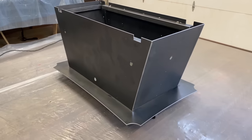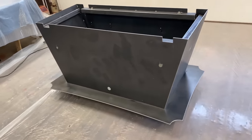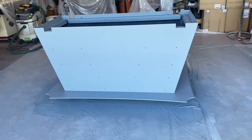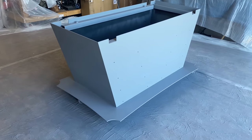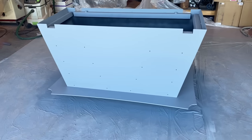Okay, bodywork's done. We're all prepped for some color. We're about to hit it with some primer. All right, one more coat of primer to go. Everything's been sanded in between to 320. After the final coat, we'll sand to 600 and put some color on this thing.